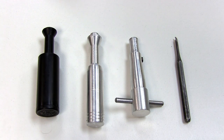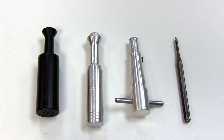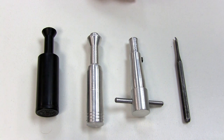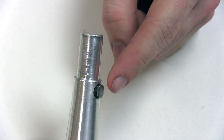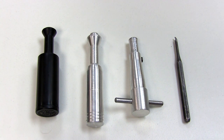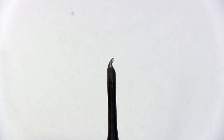We will also show the install and removal with some of our special made tools. In our application guide, we sell this plastic disposable push style tool, which can be purchased in 927 and 990 diameters. It can also be purchased in metal from the manufacturer, such as this example here — we actually made that here on our small lathe. These versions have been modified to add a little extra support for the pin. The last install tool here, the aluminum version that we also made on our small lathe, uses the OD of this dowel pin and the ID to center itself in the pin. It's mainly made for our tanged clips, but also works very well with our non-tanged clips. Our removal tool here is actually just a modified punch that can easily be made in your garage in about five minutes — it's just got a small 90-degree hook and a little beveled edge.